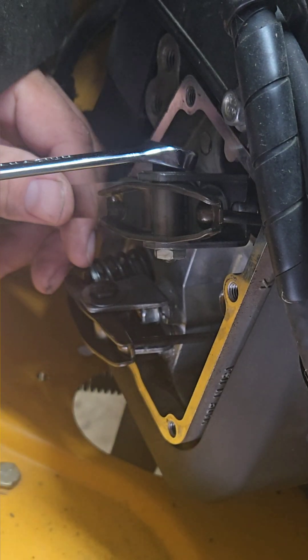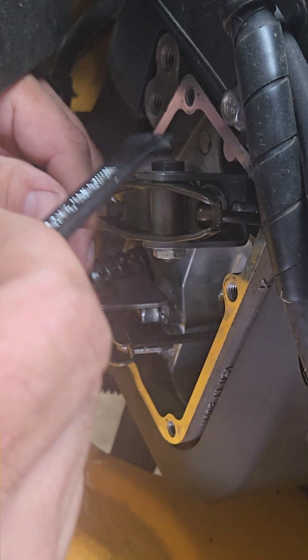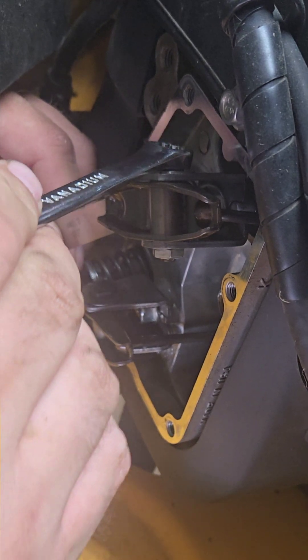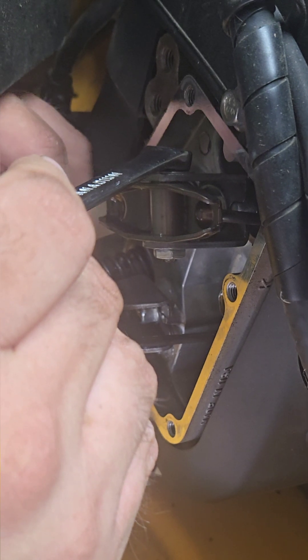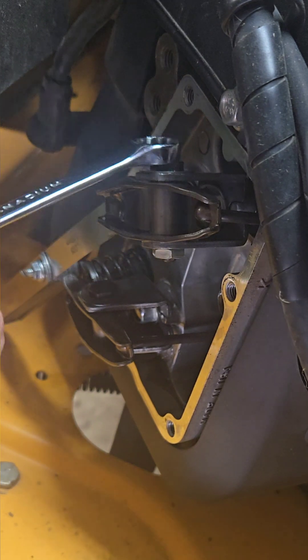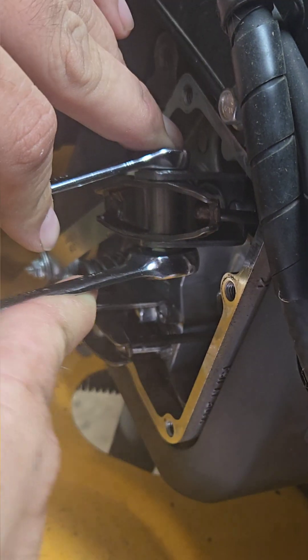If I'm a little bit this way it's loosey-goosey, just a little bit here and I'm already starting to tighten up right there. I could basically let that hang and it's holding it — that's actually really sensitive, which is kind of cool. I'm going to hold this until I get just a light little resistance under the valve and the rocker stem, then go ahead and tighten the jam nut while holding this in place. I love ratchet wrenches.